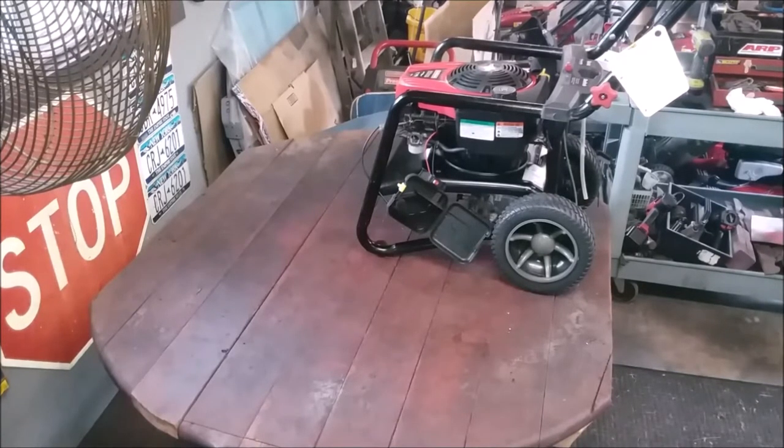All right, so it's just about aired out in here now. Let me take a look a little closer in. Probably a little grainy, but just to show you. This is aluminum, and a lot of times aluminum pumps just go bad because of the fuzz that grows on it, the oxidation. So what we're doing here is I'm taking one of my pipe cleaners.